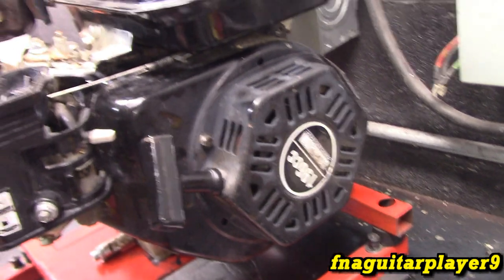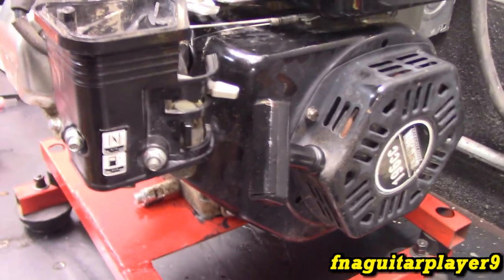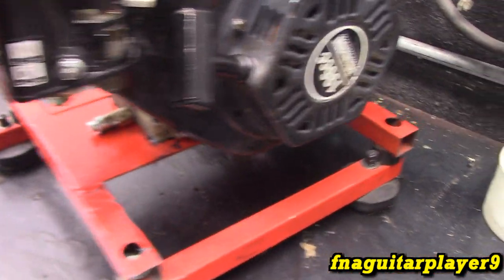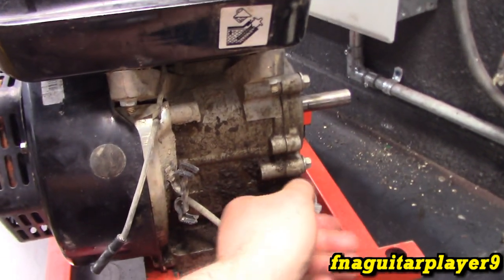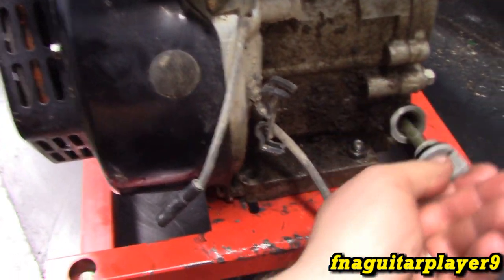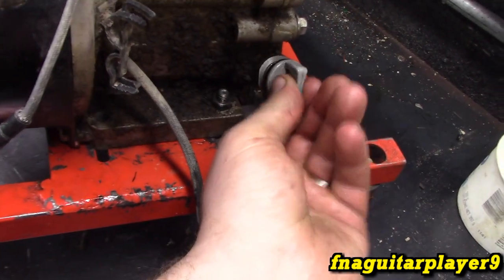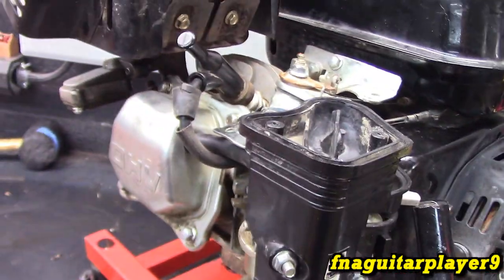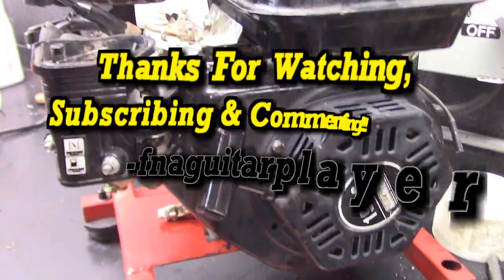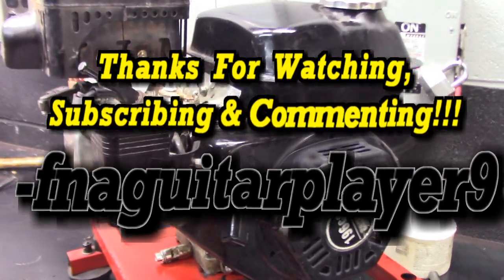Well guys, I think we'll call it a runner and it doesn't smoke now - that was just oil built up in the muffler and what I put in the cylinder. It still only wants to run on half choke because I can't clean out that stripped jet, so I can pick up a carburetor for it. I did change the oil - I put used oil in it that came out of an engine I just flushed. I'll probably change it again to make sure there's no moisture left. It's a really good backup engine if we ever need it for some experimental stuff. Thanks for watching - if you have any questions or comments feel free to leave one below.